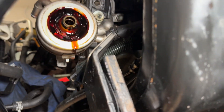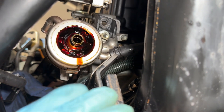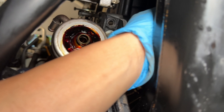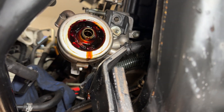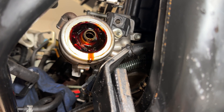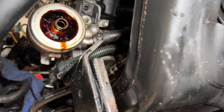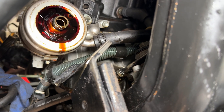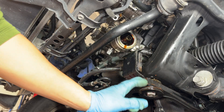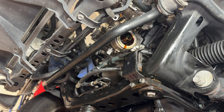I'm gonna have to run some diesel in the oil after this just to clean it all up. One of the things I had to do with the water pump service was actually relocate and unbolt the AC compressor, but if you were just doing this job you'd have to take apart this bracket right here — two 14-millimeter bolts — to access the bolts for the actual oil cooler. In addition, I'm gonna take apart the coolant line on the lower part; there might still be some coolant in there. Removing this little shield that diverts the oil will help give a little more room.